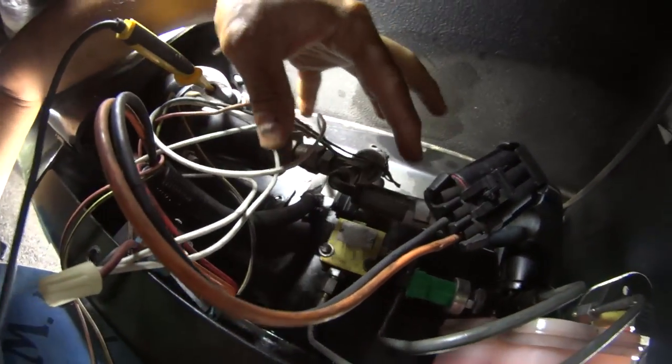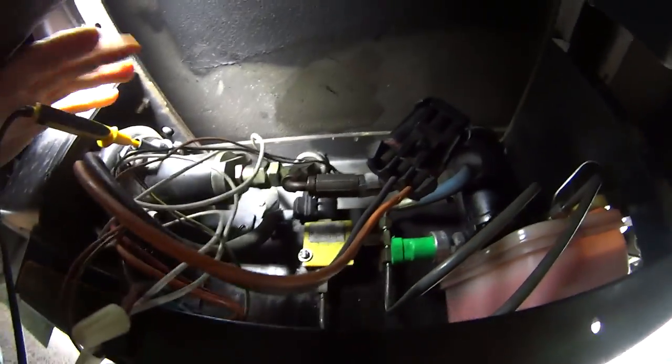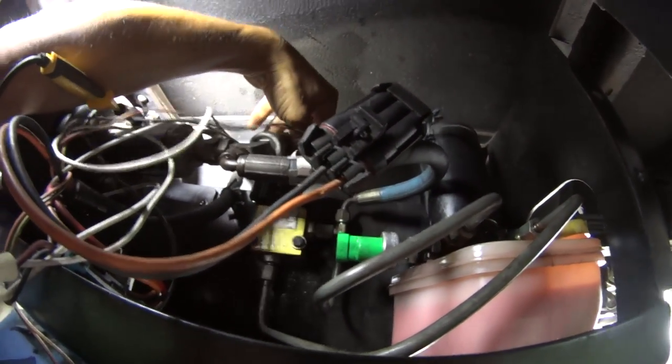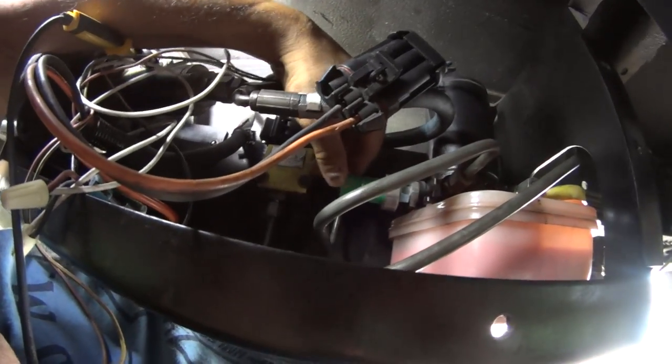It loses pressure inside the system, which then of course energizes the brake, which it is energized right now. It's spring loaded. It's hydraulically loaded. It's pulled backwards. So once again, what do we have? We have a switch, a pump. You know the pump's working when you see your hydraulic ram go, and I'll show you that with the car running. This is all actuating.